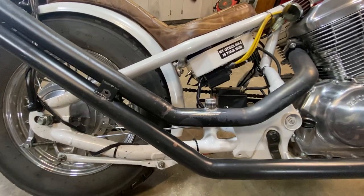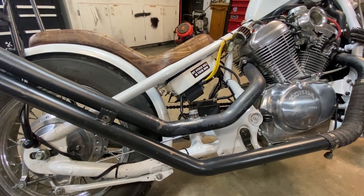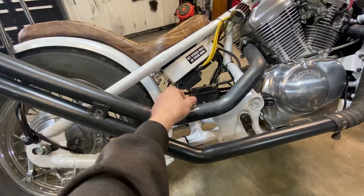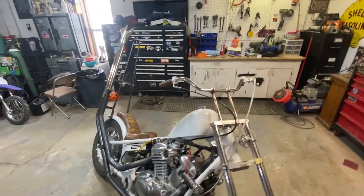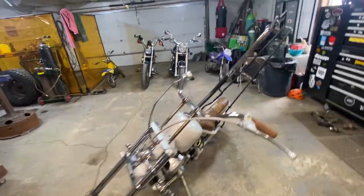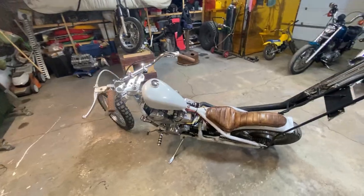And then last winter, I'd bought an AEM air fuel mixture gauge. I welded in the bung here. And if you breathe on those things the wrong way, you foul the sensor. So I used it for maybe 5 minutes, one ride, found out it was idling a little lean. But that's about it, took it off.